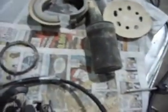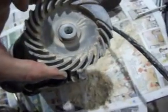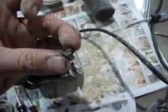And you have to take the housing off. There's 1 screw on each side there, and then you'll get to this impeller type fan that fits on this shaft here, and that'll slide off. There's this little screw here that just goes into the end of the shaft, and then the fan thing will just come off of there. And you can finally get down to the motor.